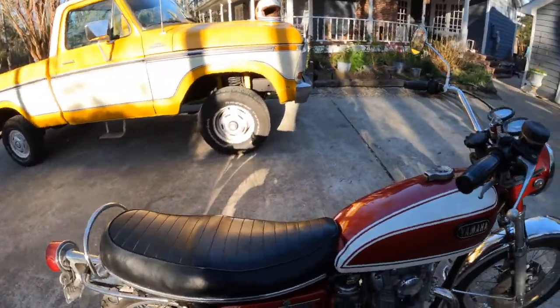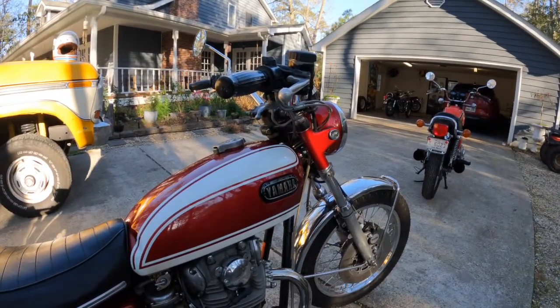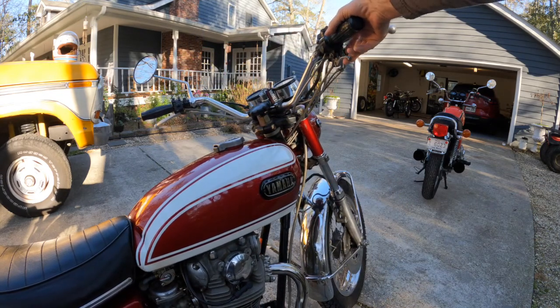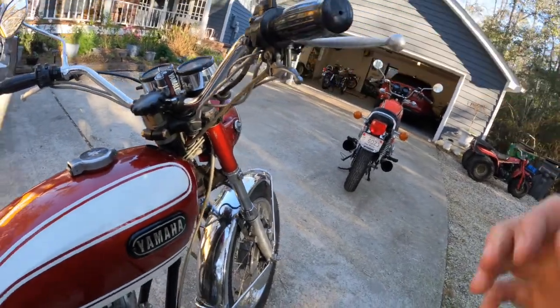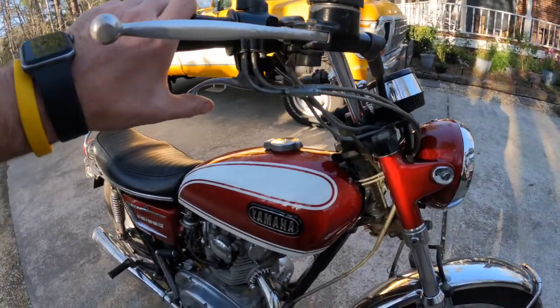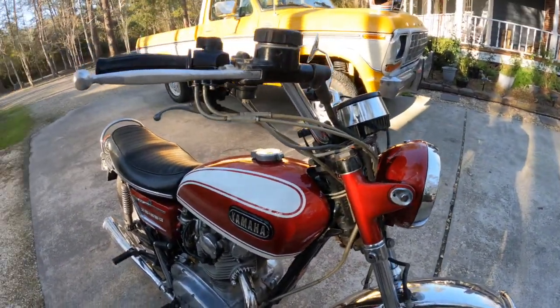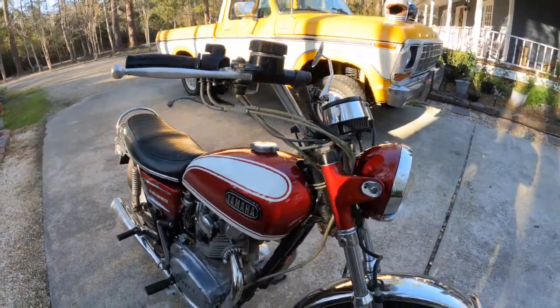the starter button. For those of you who don't know, the starter button is a combination, right here, this lever right here, as you can see, that lever right there, which is a combination starter button because it works like a brake switch. You see it's got on the inside, once you pull it far enough, it'll start it. But it's a combination button and a decomp lever.